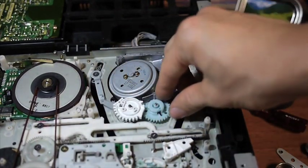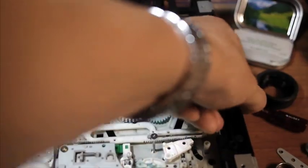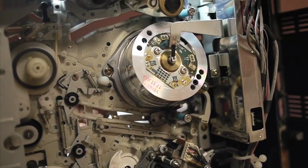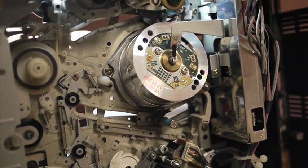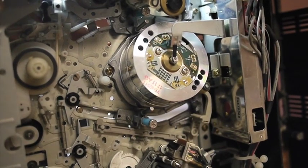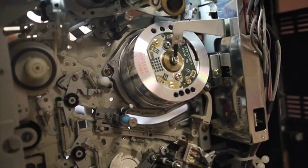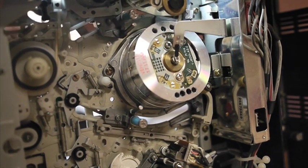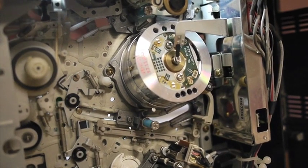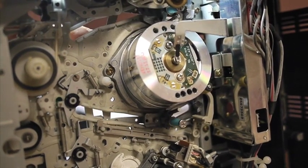These arms help to push the tape against the video head drum. And if you want to see it from another angle, the two blue things here — this and that — should both be pushing at the same time. The tape goes between the two blue things, and when the gears turn, they should roll the tape around the video head drum.